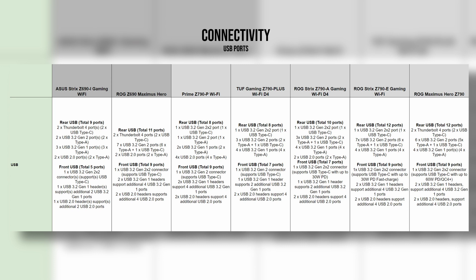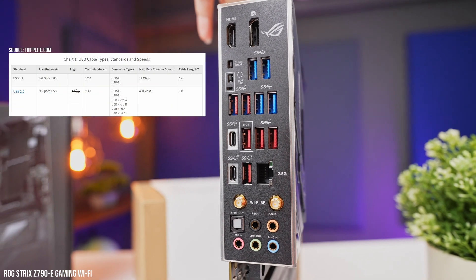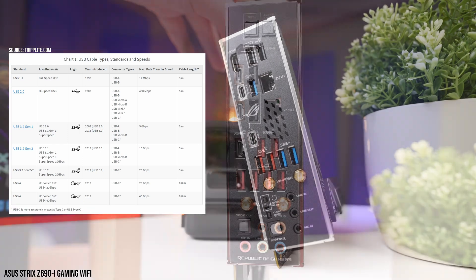Have a look at this table. The information is broken down into front header connections as well as rear USBs. Do bear in mind that for front header connections, you'll need to ensure your case, or even separate modules you install, support what you're aiming for. On the Hero motherboard, you can have front panel USB 3.2 Gen 2x2 with 60W charging, but you must install an additional power cable to the motherboard. At the high end, we now see boards with multiple Thunderbolt 4 ports in a Type-C connector. To quickly summarize: we have simple 2.0 ports with 480 megabit speed, then 5 gigabit ports, 10 gigabit ports, as well as 20 gigabit ports. The aforementioned Thunderbolt 4 runs at 40 gigabit.